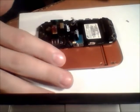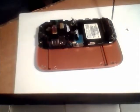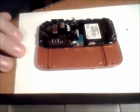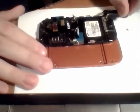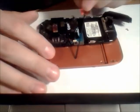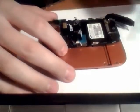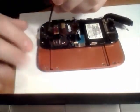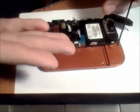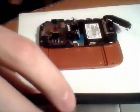It might actually be easier to go that route now that I'm looking at it. I'm going to go ahead and attempt to do the four and move this one and see where that takes us. There's actually a screw down here towards the end of it — this is where the antenna goes in towards the bottom of the phone. There's just one silver screw you can take out, and then you can take off this entire piece. What you're trying to get to is this orange piece so that you can get to the LCD. Instead of moving the slider component completely, we can pull off eight screws, and that way we'll be able to get the plate off without having to mess up the entire sliding component. Once you mess up that sliding component, it's very hard to get it back on.